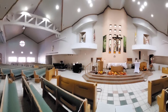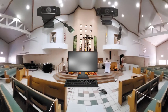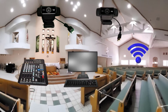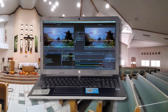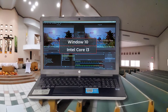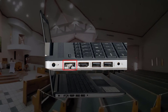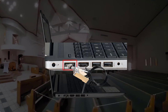The most important piece of equipment in the setup is the computer. It will be receiving video from two web cameras and audio from a stereo mixer, simultaneously transmitting it to the internet through Wi-Fi or ethernet. Although you can use a desktop computer, you can't beat the portability of a laptop. We recommend using the latest version of Windows 10 and an Intel Core i3 processor with at least 8 gigabytes of memory. Use a laptop that has an ethernet port. Connecting to the internet with an ethernet cable provides the best connection for live streaming, much better than Wi-Fi.